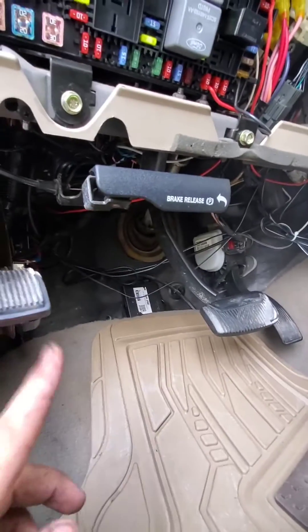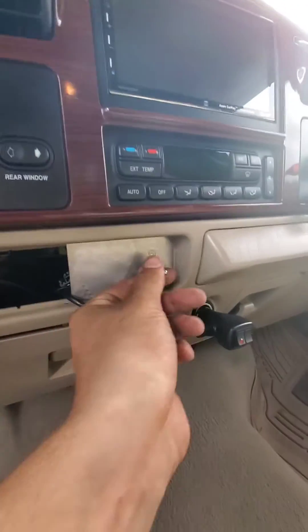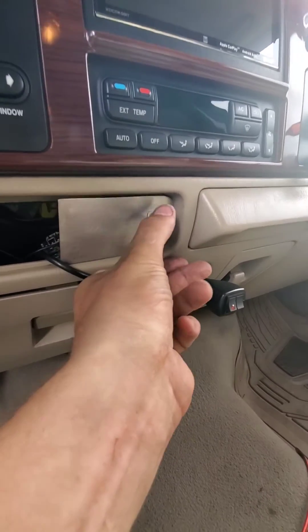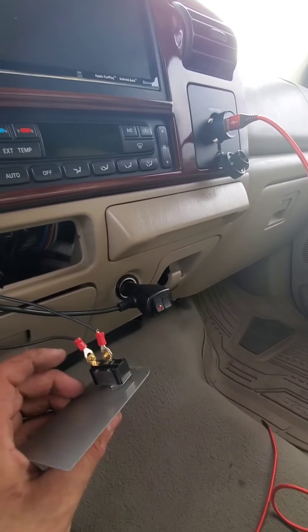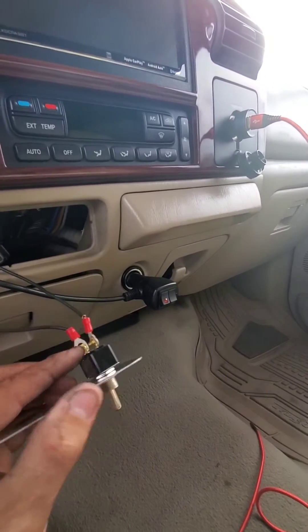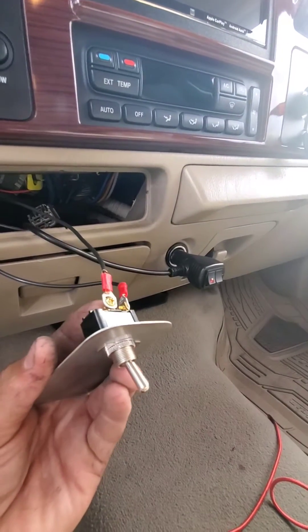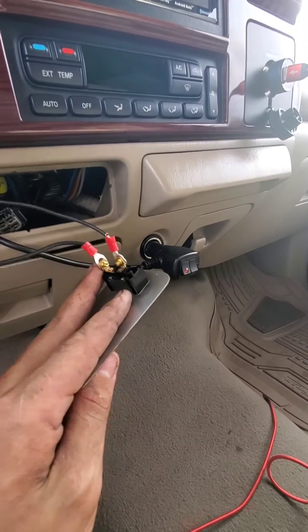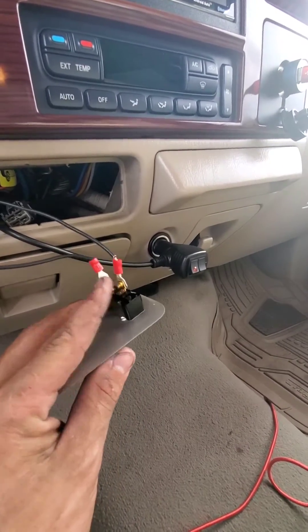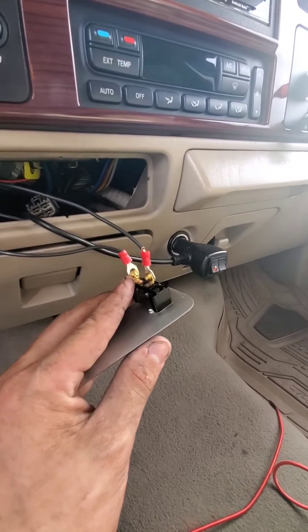So basically I came in through the firewall and I took the wire over through here, up into here. Here's my switch right here — on, off. It's just loose yet. Basically the wire will be coming into one side and your ground is into the other. I'd advise having at least a 10 amp switch on it.